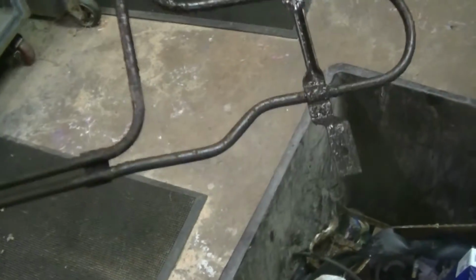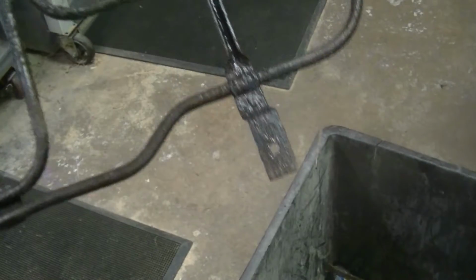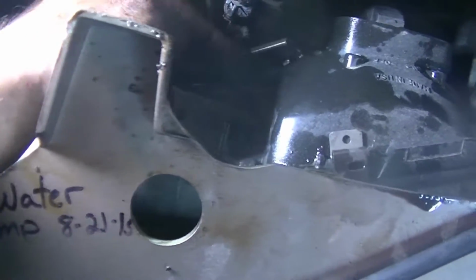Alright guys, very sorry I didn't show it, but I need to get this truck out of here pretty quick because I got another guy coming tomorrow. There was another bolt on the bottom, so there's 2, and I just pulled this out. It was kind of just snapped in there, and then it kind of went in here and turned in this corner going on this side. So I had to remove the headlight right here, and to do that there's this little adjuster bracket that just had a bolt that goes into the back, and then it swivels like that, and so I swiveled it out of the way.